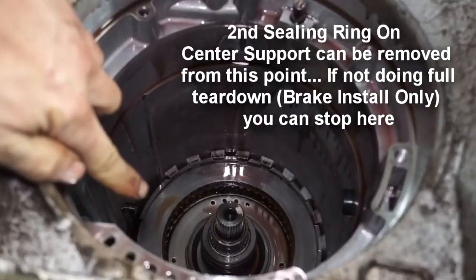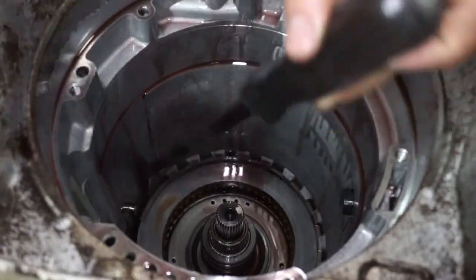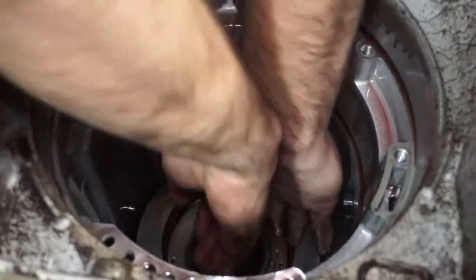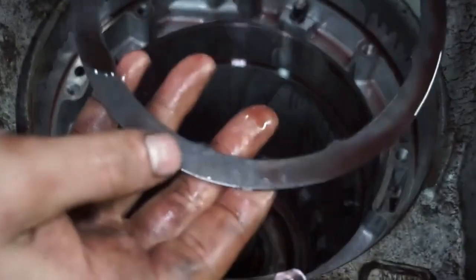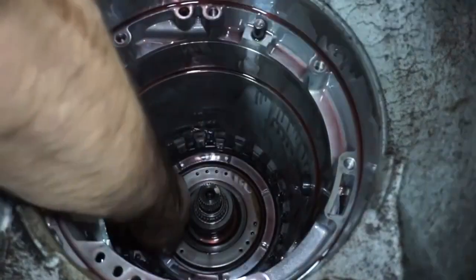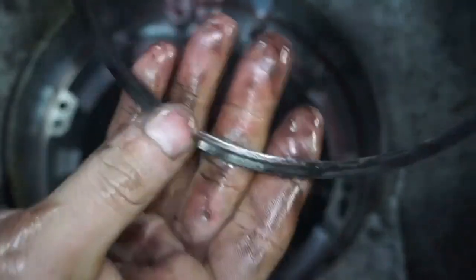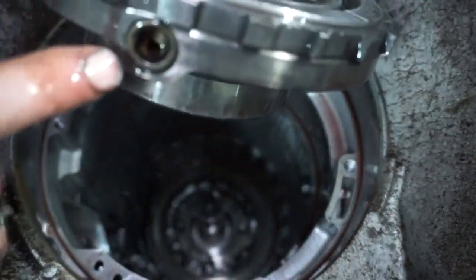Next, we have a snap ring right there — that's your intermediate snap ring, and that holds in your intermediate clutch pack. That's needed for second gear; I know that because I just broke this snap ring on a different transmission and lost second gear. Now this clutch pack comes out. Next you have a wave plate that didn't come out with it. And then you have another snap ring — this is called a beveled snap ring, and it goes on top of your center support. There's a little bevel that goes on the top — flat on the bottom side, beveled on the top. Now your center support part will come out. If this piece doesn't come out, you have either your bolt or your rear lube port still in there.